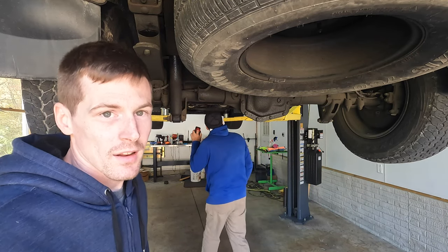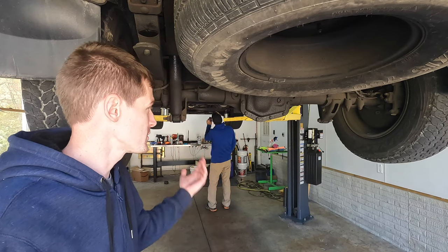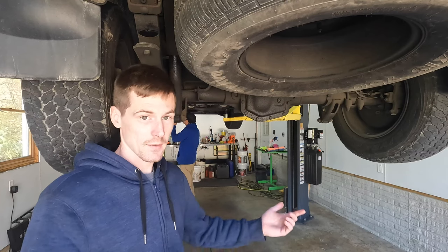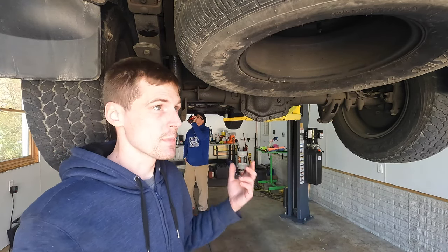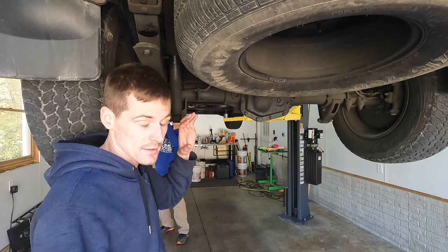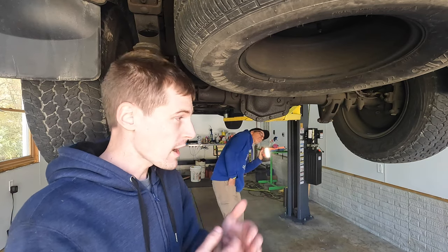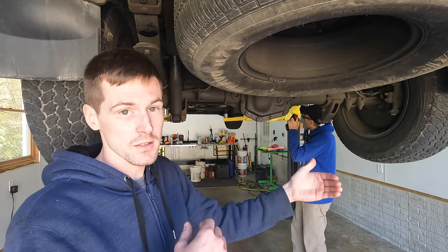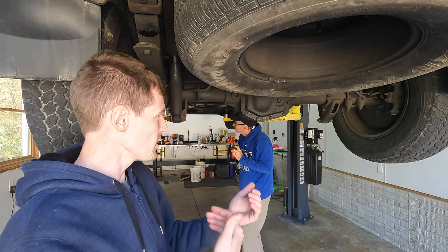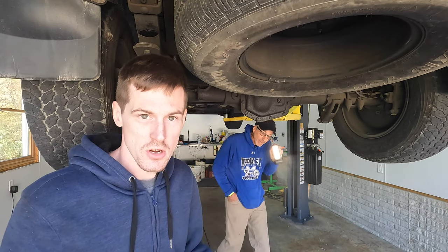There's maybe a spot the size of a quarter, but this is after five years. Last year I sprayed it with Surface Shield and this year I'm probably going to hit it again, just because he lives 45 minutes away, it's already on my lift, and this truck's only here about once a year. Realistically I'm 50/50 on whether it would even need recoating, but you have to remember this is the fifth year of lanolin coatings. If you were going out with a brand new vehicle just using Surface Shield, I'd evaluate it at one year before waiting a full two years to recoat.